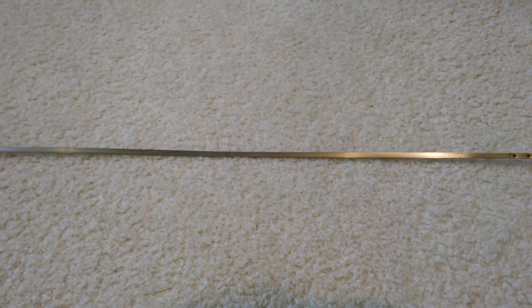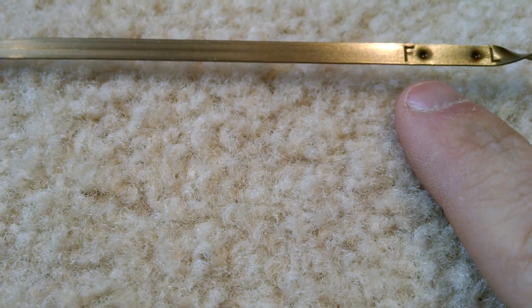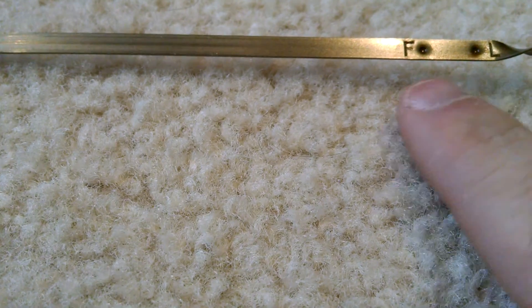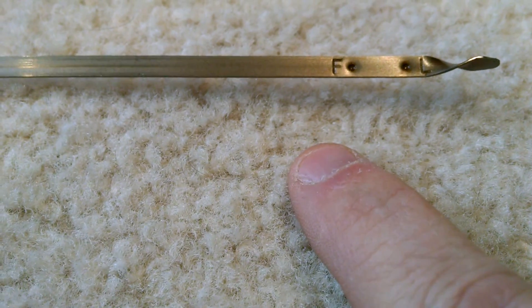They overfill it, so it is possible to overfill, which is worse than being a little low on oil. If you come down to the dipstick, you'll see the full and the low. The ideal spot is just below the full. It's better to be on the low side or even a little bit below that than be over, because you put too much pressure in the engine and you're going to blow a gasket, and it's going to be big bucks.